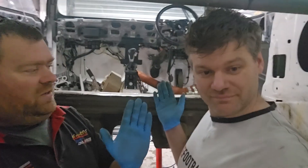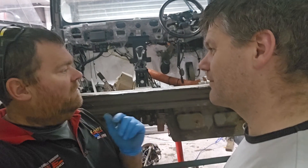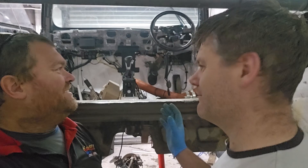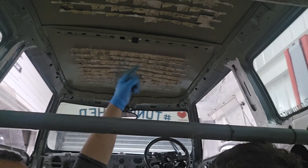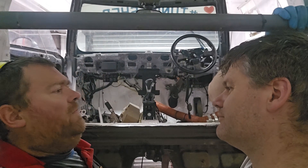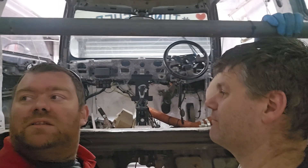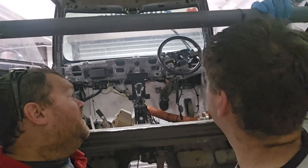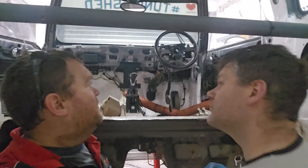So we have got loads of room — the engine's going to end here and then we've got all this room. We've obviously got to find a place for radiators, intercoolers, fuel tank — what if that's about right by the block? Yeah, let's do that by the turbo. And we're going to need some sort of bulkhead here as well — we can go straight up from this to there and then we've got all this back further. Thinking an ally or plastic? Maybe clear? I'll have a window — make the whole thing 8mm clear. We'll think about that; either way the bottom bit could be metal so it can be removed with something.